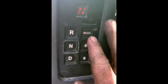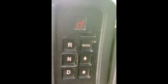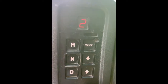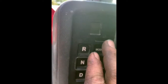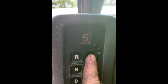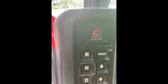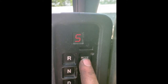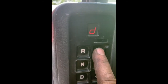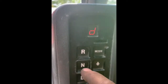To pull codes on this, turn your ignition on, then press your shift arrow buttons up and down at the same time. You'll get D1: 2-2-1-5, so your main code is 22 and the subcode is 15. To go to D2, hit your mode button — D2: 5-6-2-2, so 56 is the main code and 22 is the subcode. Go to the next one: D3 is 5-4-4-5, same thing. Keep hitting the mode button to cycle through. D5 just shows no codes — it's got a hyphen in there.